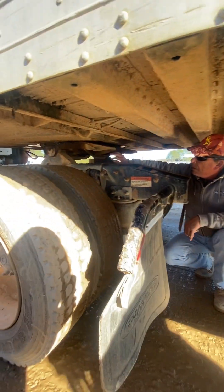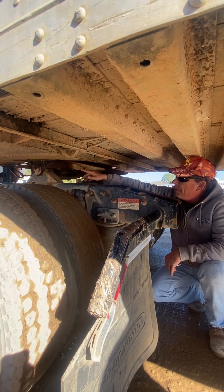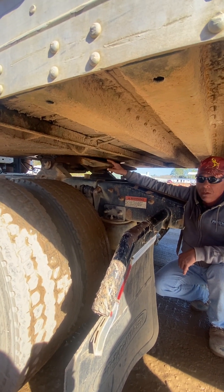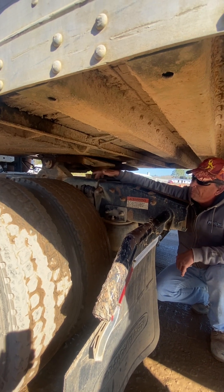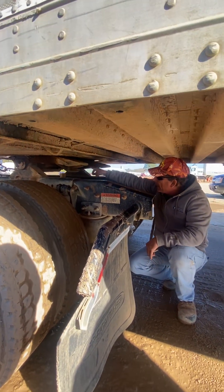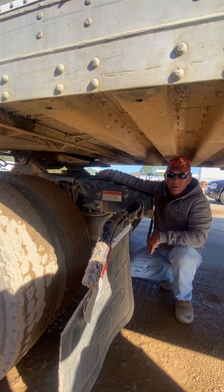Let's talk about my fifth wheel. Since I have to include coupling with this — looking at my apron, make sure it's properly mounted and secured, not bent, broken, or damaged, no excessive rust. There's no gap between my apron and my fifth wheel skid plate; you don't want to see any daylight between them. The fifth wheel appears to be properly greased. My fifth wheel is welded to my platform, and this platform is properly bolted to the frame of my truck — same number of bolts on both sides, none missing, and they appear to be tight. Back here I can see that my jaws are closed around my kingpin, around the shank of my kingpin, and my kingpin is not bent, broken, or damaged. This is the only place I can see it when the trailer's hooked up.